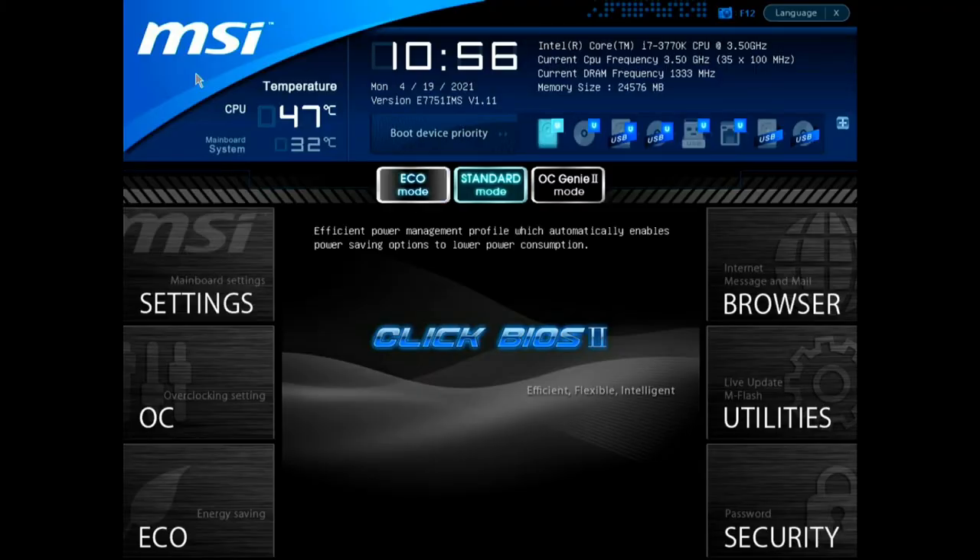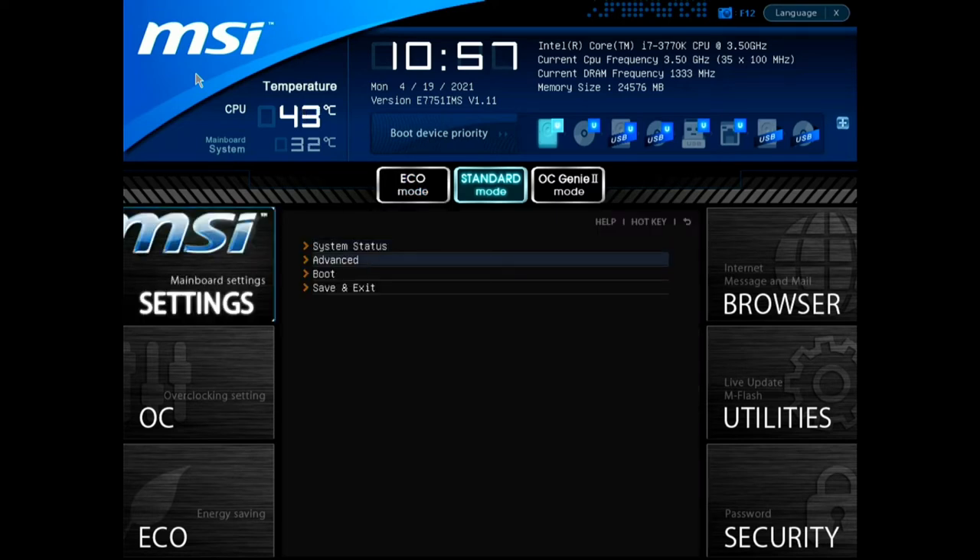So how does my use case work? If you've got an old computer laying around or a NAS system, you'll first need to check your system's motherboard configuration and find the setting that enables Wake on LAN. If you have a system with eco settings built in, you may need to switch off the eco saving features and enable Wake on LAN under your power-on options to allow the system to power up. This is how I've done it on this MSI motherboard.